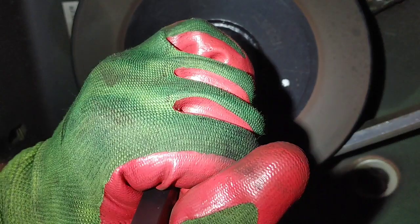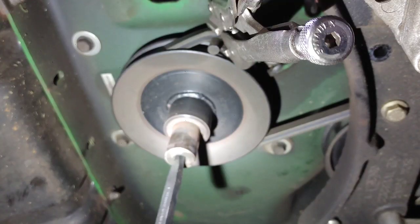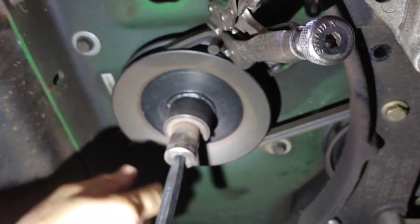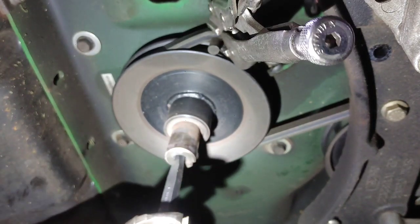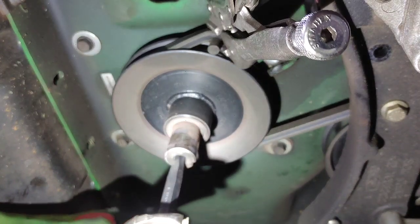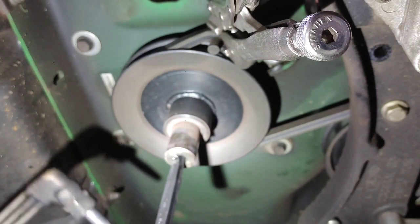So I'm going to have to figure out a way to keep that engine crank from turning while I apply enough torque to remove that bolt. What I did was put a pair of vice grips here, clamped down to that belt right there on that belt guide — that pretty much secured the engine from turning. Now I'm putting enough torque on this extractor to where I'm in fear of breaking off the extractor into that bolt, so I'm going to apply some WD-40 and let that soak in.